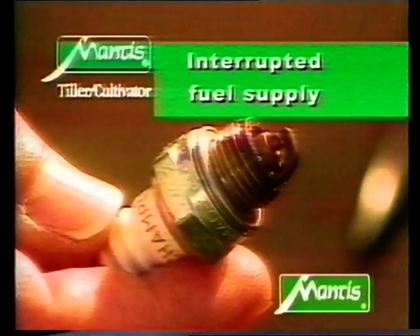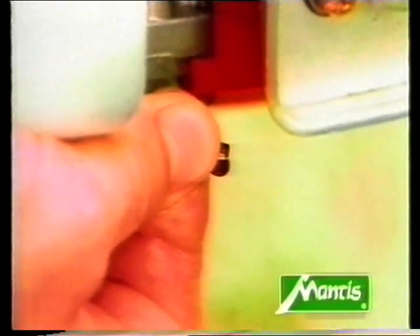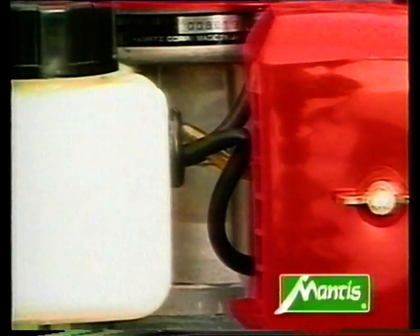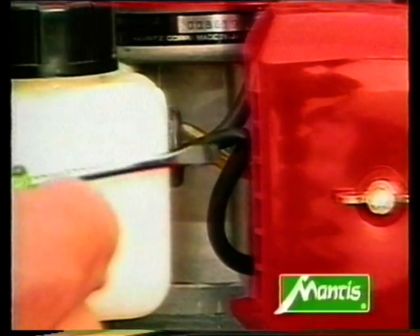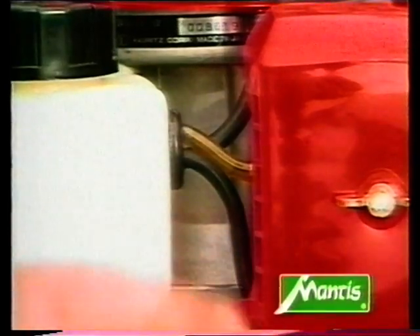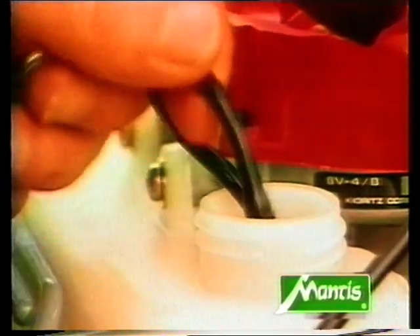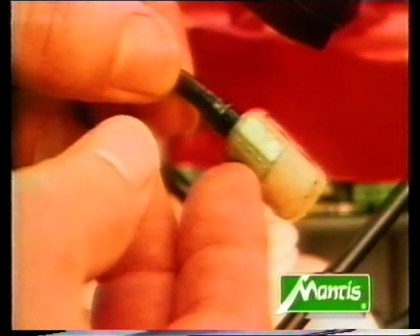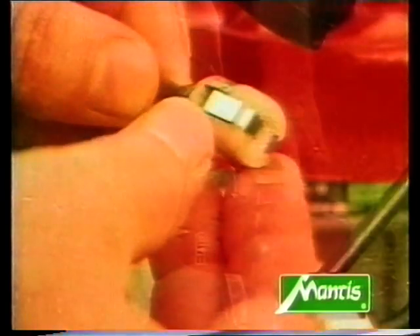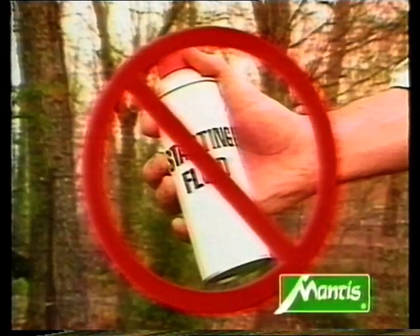What do you do if the spark plug is dry but the motor still doesn't turn over? In this case, it's nearly always the fuel supply that's interrupted or jammed. The fuel line runs directly from the fuel tank to the carburetor. If you pull the line out at the carburetor end, the fuel should slowly drip out. If this doesn't happen, check the line for any kinks — kinks in the pipe interrupt the flow of fuel, but this is easily put right. If too much fuel comes out, it could be that the filter has come off the end of the pipe in the fuel tank. Attach the filter to the pipe again and start your cultivator as usual. A warning: never use starter sprays — they damage the motor and nullify the manufacturer's guarantee.